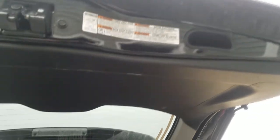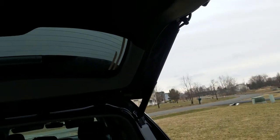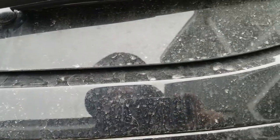Alright, so if like me you had the door open when you removed the negative battery lead, it won't go down — it'll just beep twice. Basically you've got to reset everything. Pull it down. It's working now. Basically it beeped twice and it wouldn't go down, so you've got to reset. Just open and close the back window and then it should work.